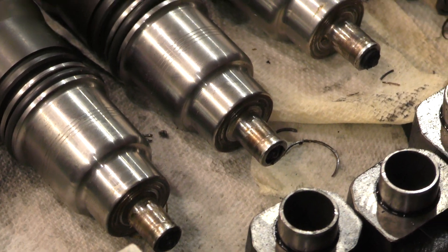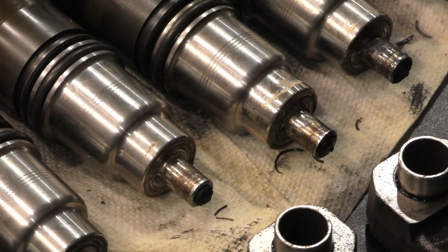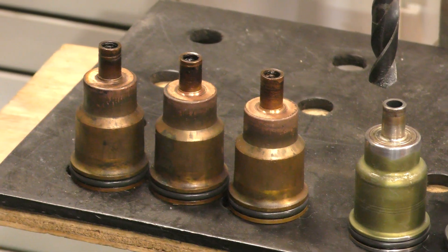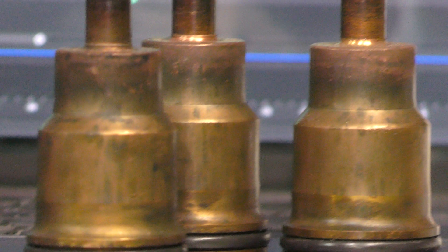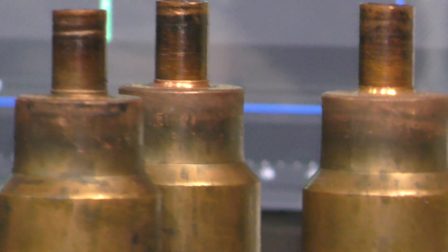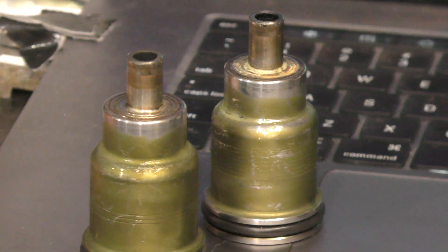Right off the bat, I want to point out that we pulled stainless steel cups out of our head. This isn't always the case. More often than not, especially on older engines, you're going to find brass or copper cups, which are non-conicals or flathead injector cups. People refer to them as brass cups, copper cups, flathead cups — just know that they are not conical cups and they're not stainless cups. They get removed entirely different too. You'll actually thread the tip and then pull the entire cup out with the threads you made with a special tool.